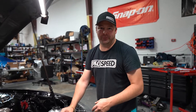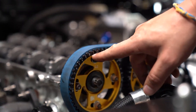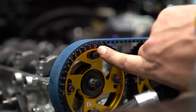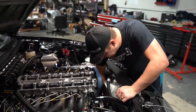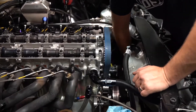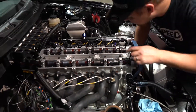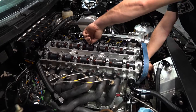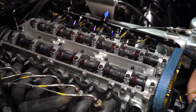I want to make note — somebody's probably going to point this out — if you look at the front, it looks like the exhaust gear is a little bit off, but it's actually not. It's because the previous cams had some adjustment in them. If you look at the actual TDC mark, it's on this dot right here, so it's pretty much straight up. We will be adjusting these cams on the dyno. Everything's tight. I like to spin the motor over one time by hand just to make sure you don't hear any funny noises, no tight spots, nothing weird — make sure everything's actuating properly and the lobes aren't hitting anything. This head was clearanced for a big cam, so it should be fine. Also check the cam sensor pickup and make sure it has a little clearance so it's not going to hit anything.